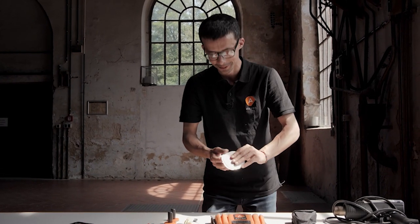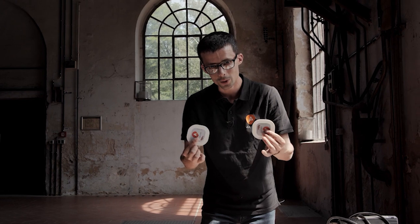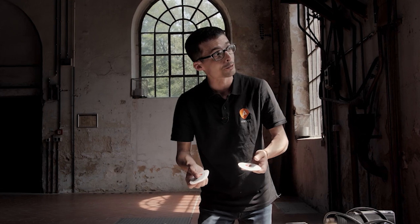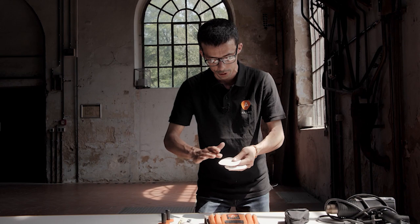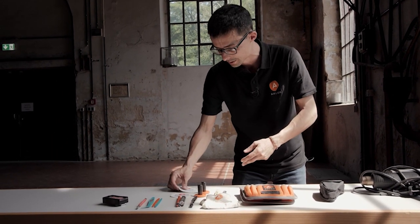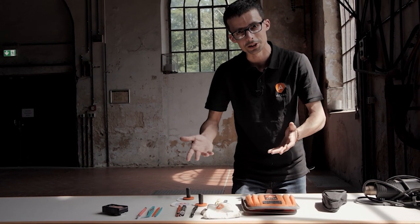This is a funny one — it's called a gecko patch. It's not the most useful tool of all time, but it comes in use sometimes. It is made for when the car is made of plastic, or when you stick a vinyl on top of a window. We've all gone mad with the magnet not working on a surface, making us use tape, which is time consuming. How does it work? It's made of silicone — you just clean it with water and stick it on the surface. It sticks on pretty much every surface except ABS plastic, and you stick the magnet on top of it, holding your vinyl.